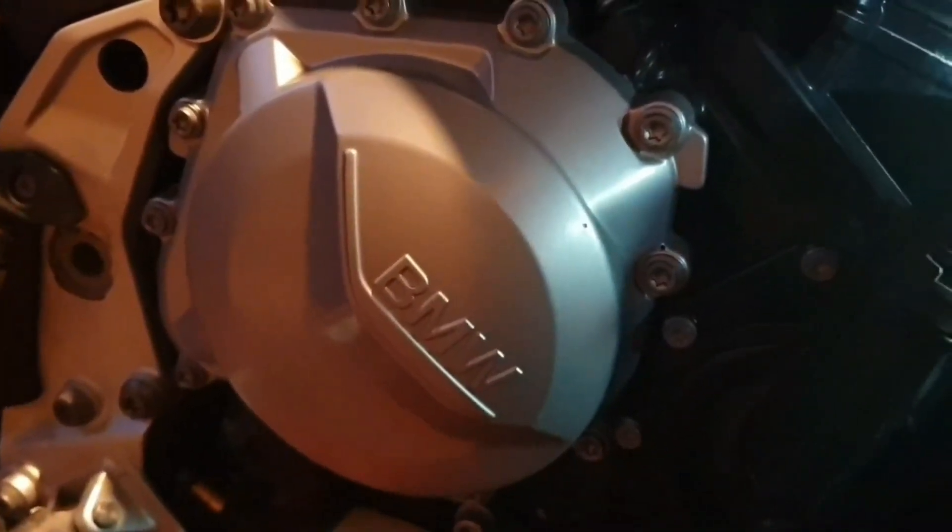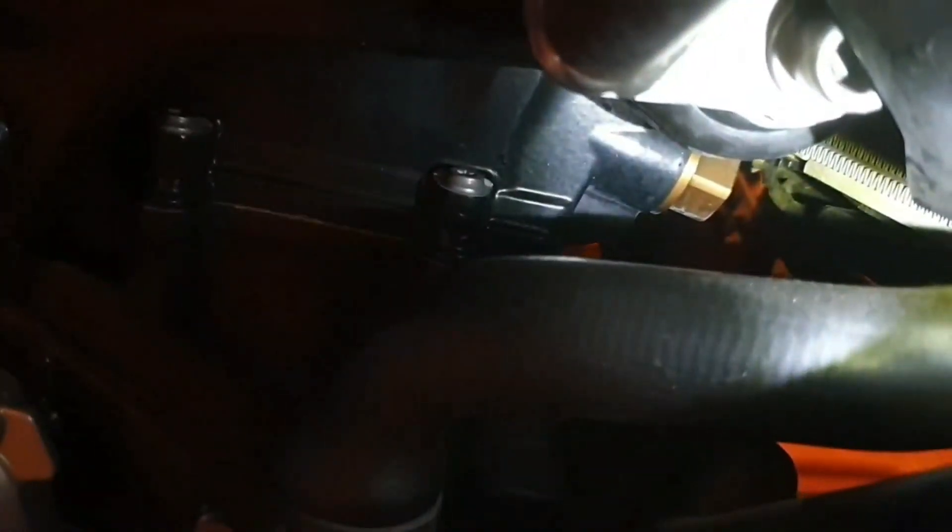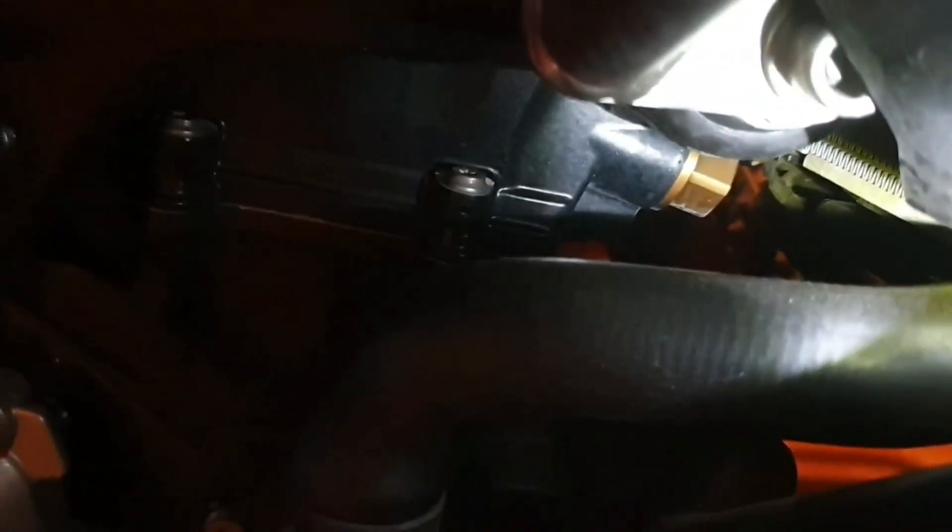I've noticed that my engine is becoming more and more rattly, so I'm going to investigate the hydraulic cam chain tensioner — that big gold bolt just below the head. We'll start the bike up now and see if it rattles. It kind of rattles and then when the oil gets through it quietens down again, so let's give it a whirl.